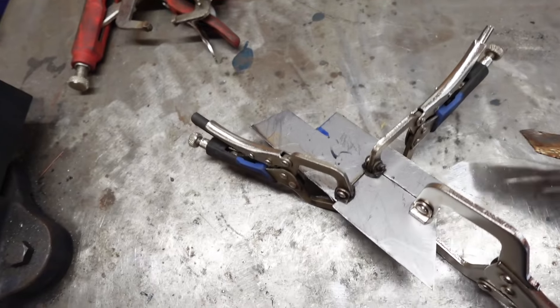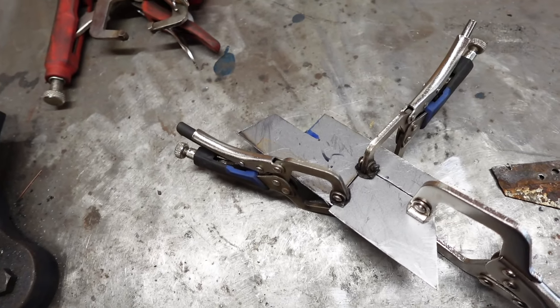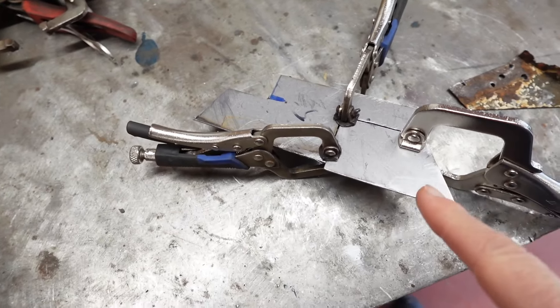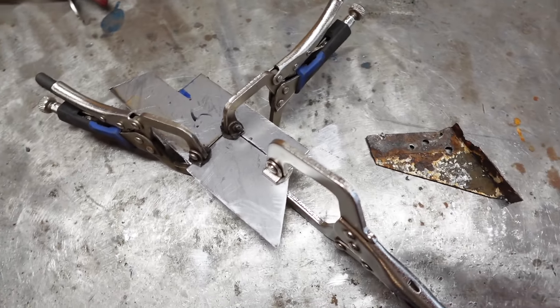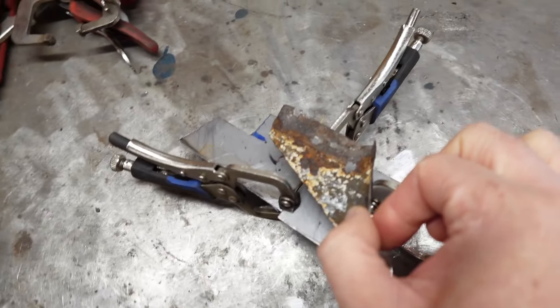So I've got to make one of these, but it's supposed to be 1.5mm steel thereabouts, and I've only got real scraps. So I'm just going to weld myself a couple of little bits together, and that'll be enough to cut that out of.